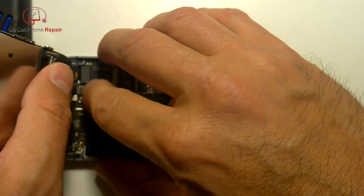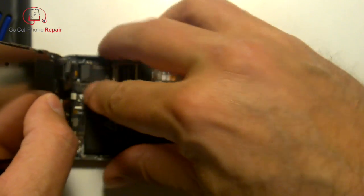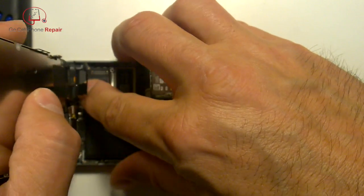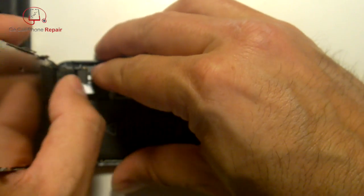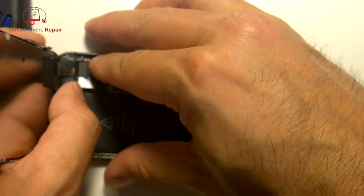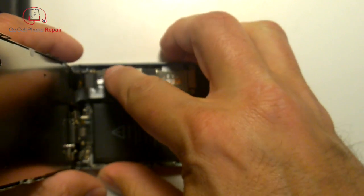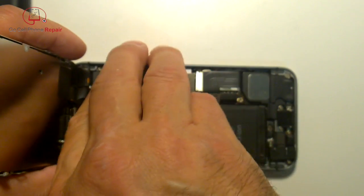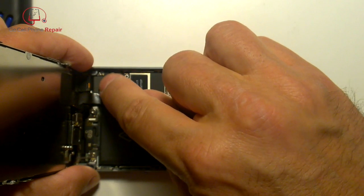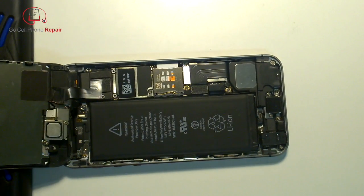These cables have to be handled very carefully. It can be tricky to get them into the right position — don't force it. You may have to feel your way around a bit as they don't always line up exactly where you want. There is one spot where it will click into place; it usually goes a little further in one direction than seems intuitive. The pads almost butt up against each other, so aim toward the top of the display to find the right position.